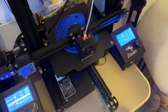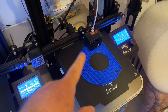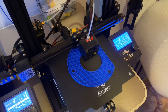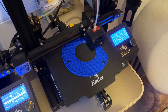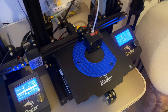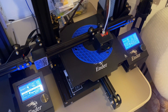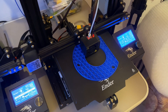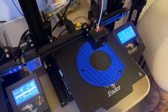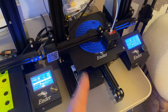When it's absolutely right I'll make a silicone mould and cast it in a fairly firm but slightly flexible polyurethane rubber. The advantage of printing it on the 3D printer means I can actually make them thicker for a higher lift, and it can also have a domed top surface. I can do it in two parts so that the concave side is underneath for the top of the strut and the convex side on top. My spacers that I've been selling have a flat top because it's a single mould and the polyurethane settles out flat. That works okay on a 20mm lift, but if I'm going to go higher it needs to shape itself to the curvature of the bodywork it's bolting into.